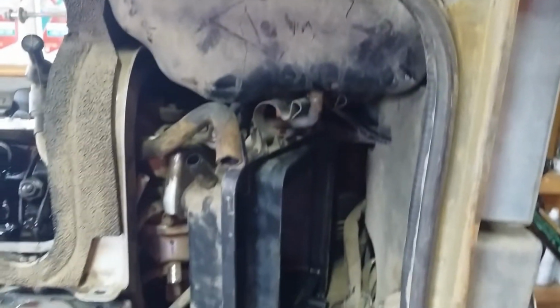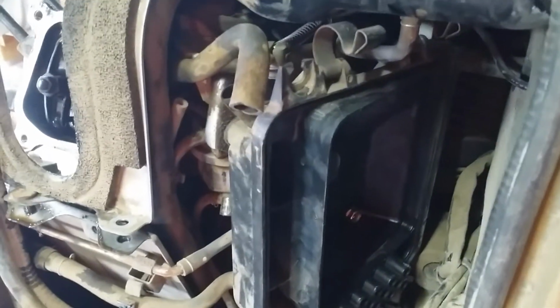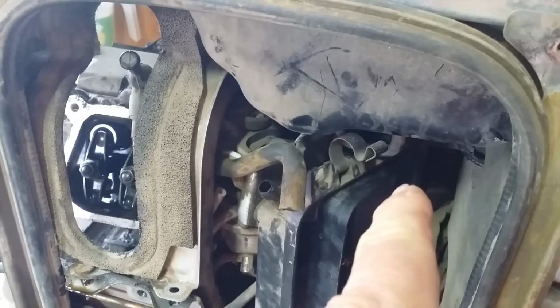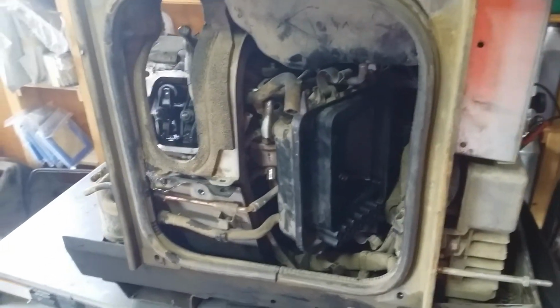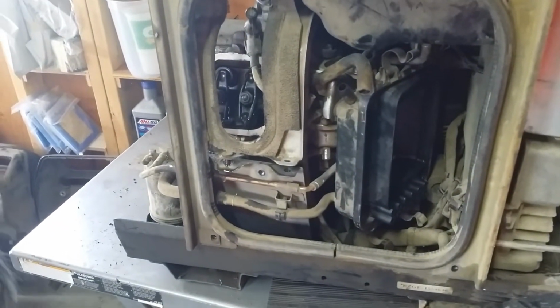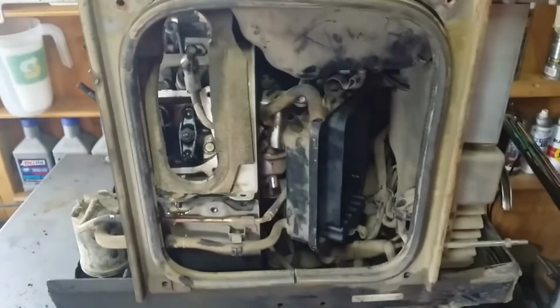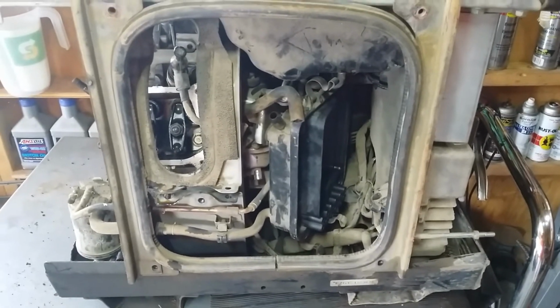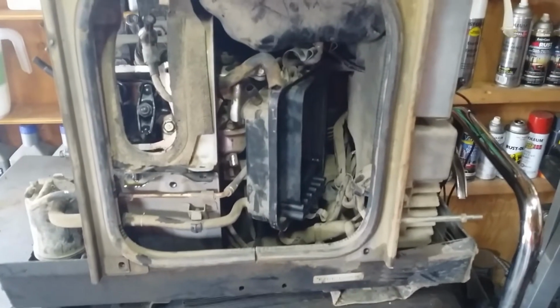So there's a kind of a filter water separator on the fuel shutoff on the bottom of the tank. We're gonna have to pull the rest of the air box out of here to get to it. So a few 10 millimeters, 2 or 3 in there somewhere. We'll pull that air box out. We'll pull a cup off the bottom of that fuel separator and get that cleaned out. And we'll probably drain the carburetor bowl in case there's water or something in there. I didn't really suspect carburetor issues, but it wasn't running perfect, but the exhaust was off of it too. All that's kind of got to be in place, your correct back pressure and all that jazz. So let me pull the air box. We'll get in there and show you what I find on that little filter separator.